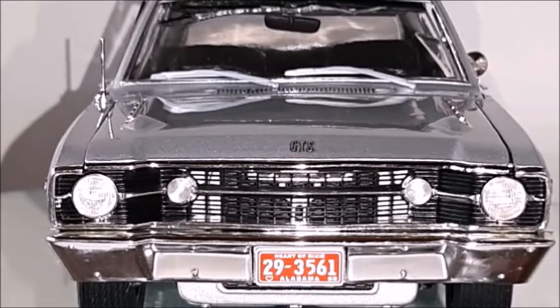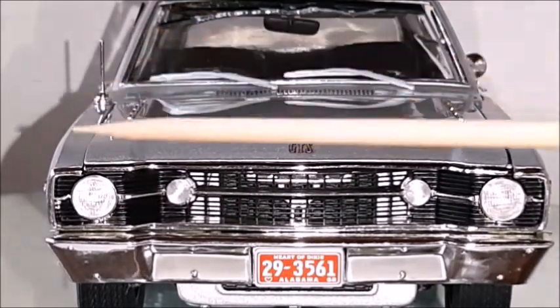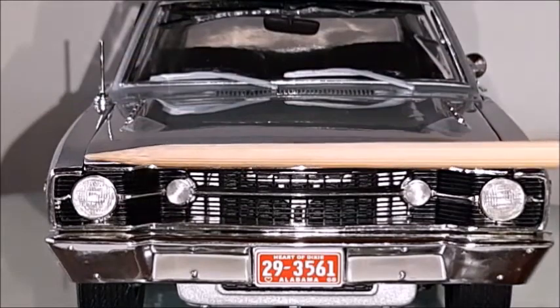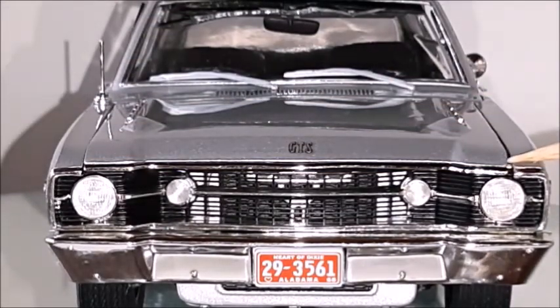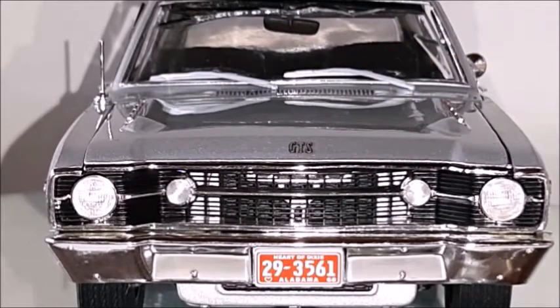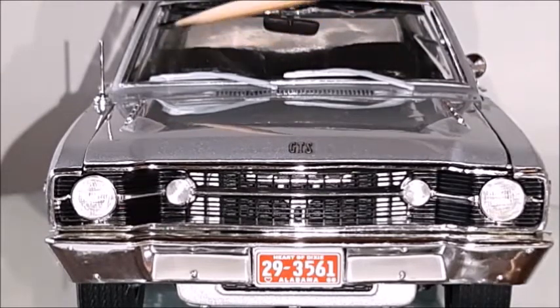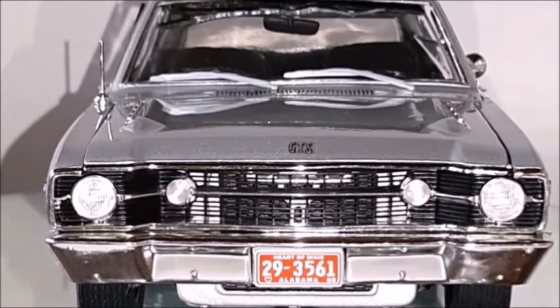The front of the car has very good quality and the grille is an actual grille. We can notice the front panel is visible through the grille. This hood has got a little misalignment — it's a little more to the right than the left side, so the gap is a little wider, and this is one of the issues I'm going to try to correct. The second issue is the windshield — it's got a crack and is a little bent to the side, probably from being overheated somehow, whether from sun or something similar, and this is something I'm going to repair someday.